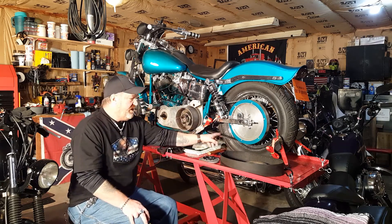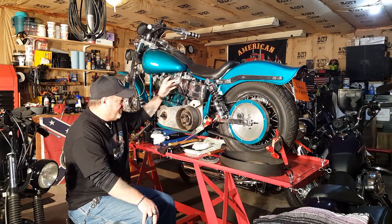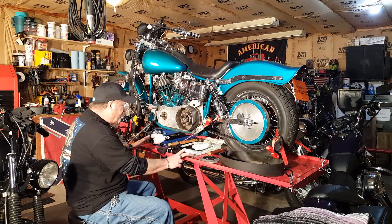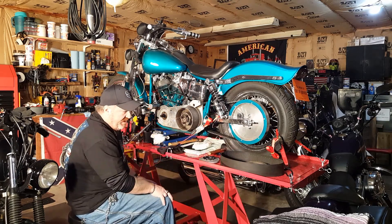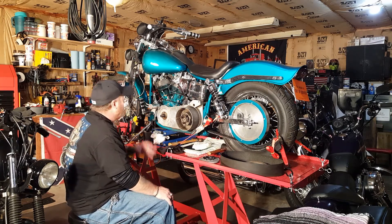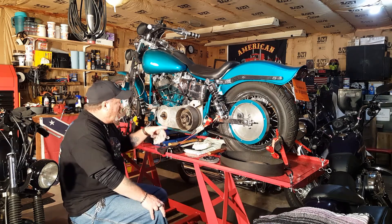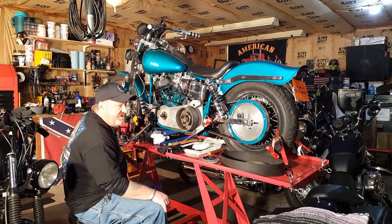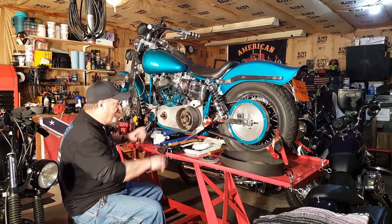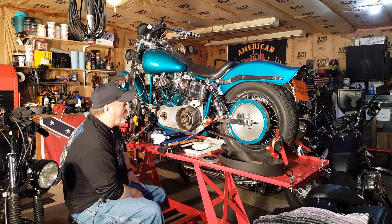Once I get this off I'll show you, because the transmission had a lot of work done to go from a chain final to a belt — we had to shave everything off the front of the four-speed transmission. When you work on this kind of stuff, make sure to tie everything down. You'll see the rear wheel is tied down so it won't spin. I'll lock down the brakes with zip ties. Once I heated that up and put the impact on it, it zipped right off.